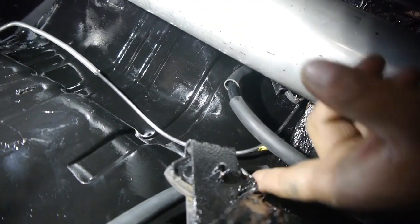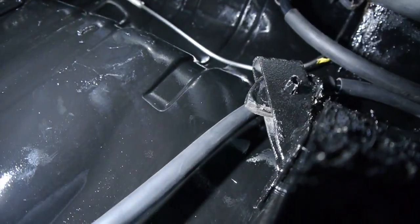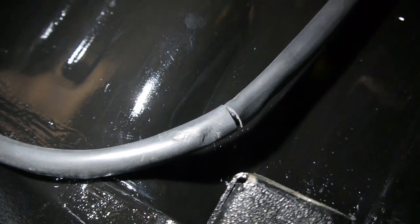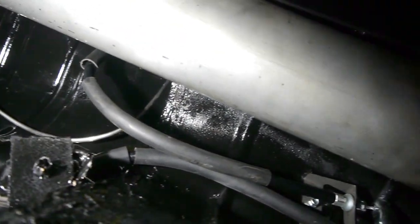The guys took off the emergency brake stuff, but they left these on, they put these back on there. And this is for the old emergency brakes. Now, the cable stops right back here. That spread out clip goes here, and then you get a bare cable that comes through here, feeds in through here, and then goes into this position.